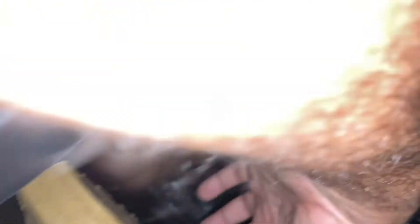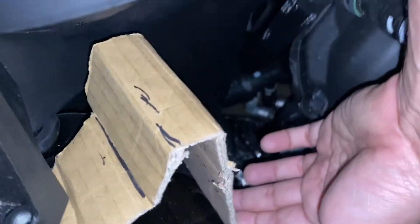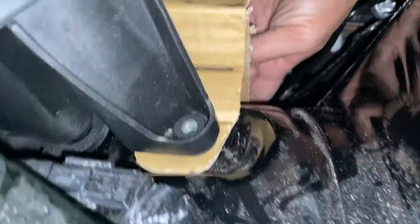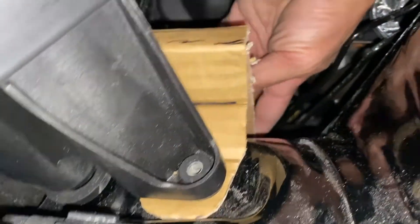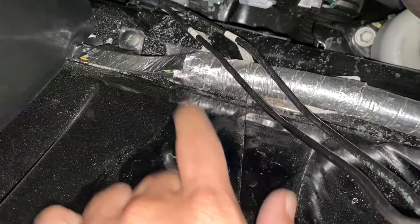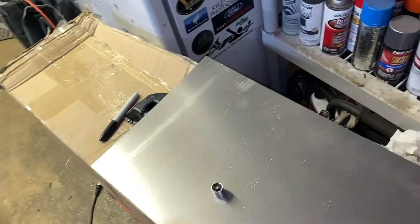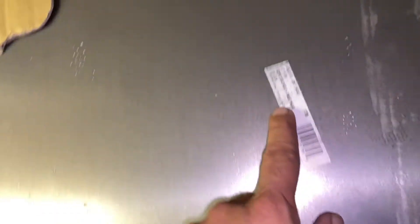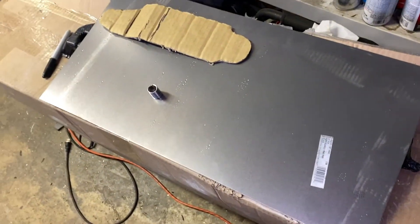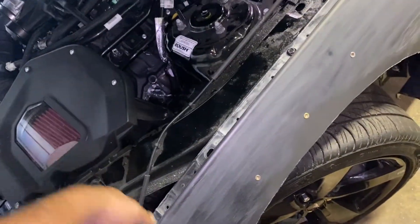I have my template here — it's going to come up, do a little bit of a hook bend, come in and mount underneath the airbox. If you look down here, there's a little bit of a dip in there, and that's where we're going to mount the bottom section. I went to Lowe's and grabbed a piece of 16-gauge steel. We're going to cut that up and that's going to be what we use for our bracketry.